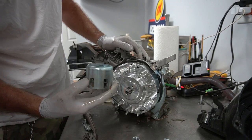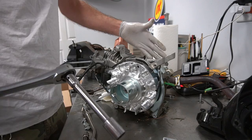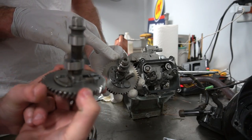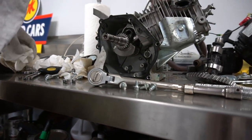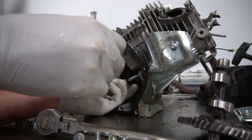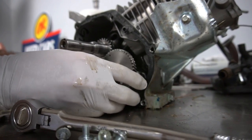Now it's time for the flywheel. Hopefully we remember — last time the pull cord didn't fit, so we have to sort that out. I'm going to wait for the final torque when we get the case on. Look at the valve lift — that's how high it holds the valve open. We've got to put in these lifters, and I kept track of which ones came out of what hole. We can do push rods from the top, so those are in.